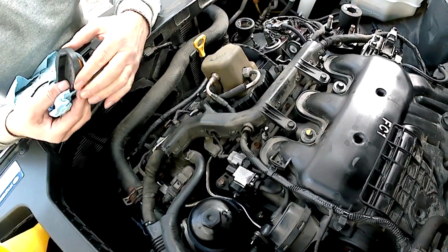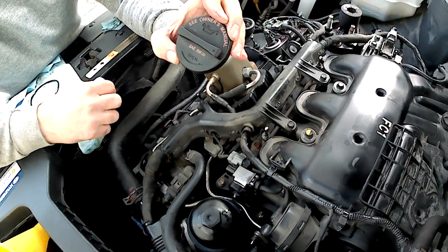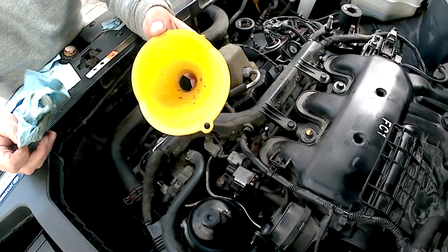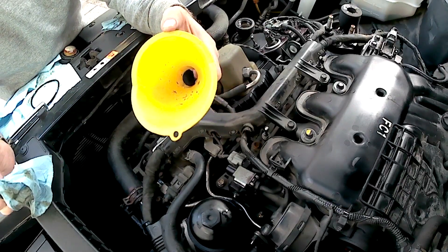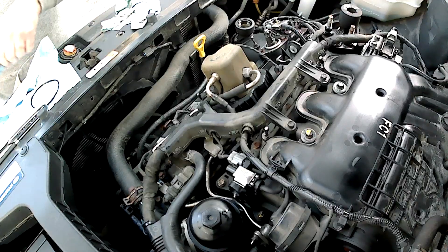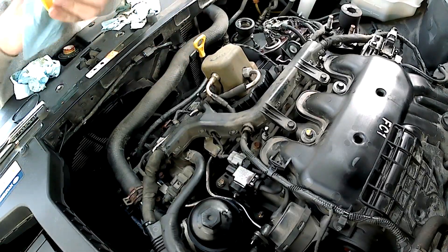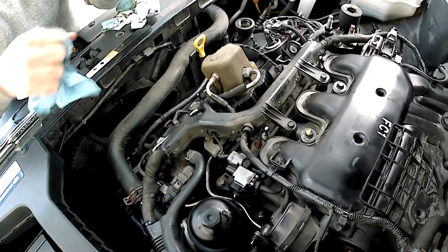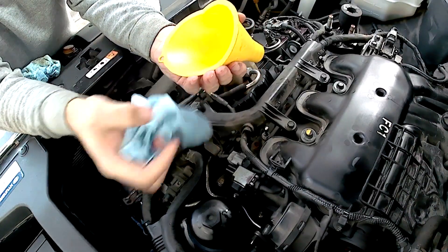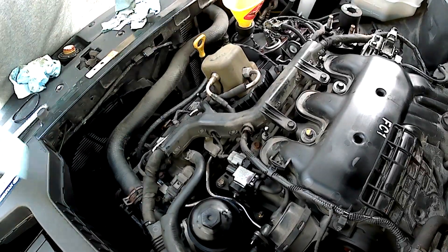Now, time to fill it with oil. Always fill it with what's recommended unless you have some serious reason not to — this calls for 5W-30, so we're going to use 5W-30. Always want to clean out your oil funnel because who knows what gunk has gotten in it since you last used it. You don't want that garbage going in your engine. Spray it with brake cleaner if necessary — anything in that funnel is going to go down into your engine if you pour oil into it, so make sure it's clean.